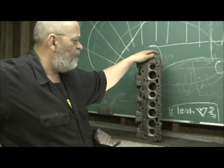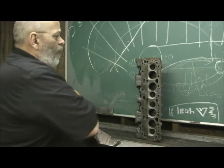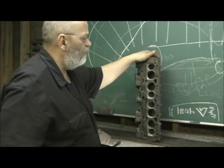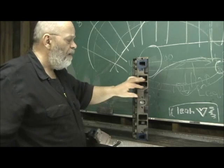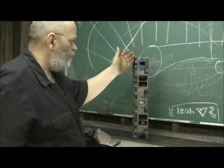What got him alerted was he could see the casting lines in the head, which is a good indicator that not a lot was done. While they did the combustion chambers and had it looking kind of pretty on the exhaust, virtually inside the ports nothing was done. They did pour aluminum in the crossovers, and it's been cut for screw-in studs and guide plates.